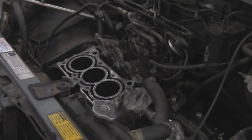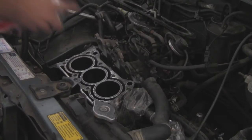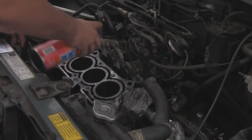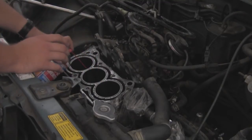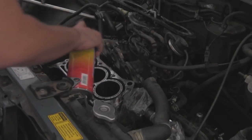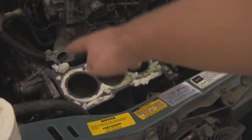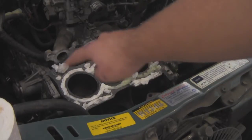So what I'm going to do, if I don't knock the camera over again, is go ahead and start cleaning the cylinder walls out like so. It's not going to really be all that dirty or nothing. The stuff dries pretty damn fast. And of course I'm going to have to wipe it down. I've got all the holes and oil galleys or antifreeze galleys around the cylinders all plugged up with some toilet paper.